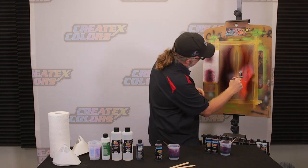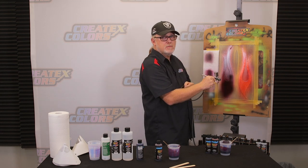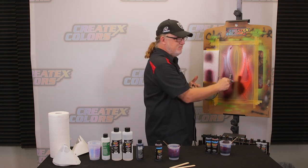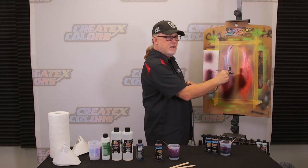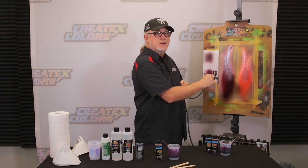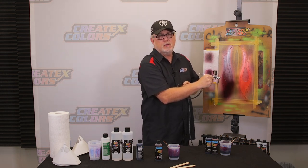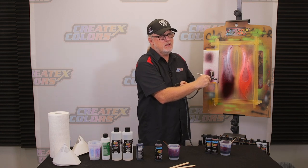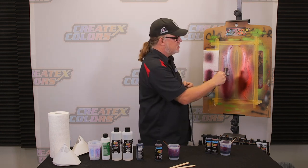Now let's say you love the color, but it's not dark enough for you. Trust me, we've only really done like 2-3 good coats. This might be a 9-coater, might be a 7-coater. Now, could you add Brandywine to candy black? Sure, that's another alternative. That might give you a color you like better. Like I said, there's not a general consensus. There's not a group that got together and decided what black cherry is.